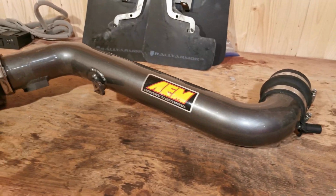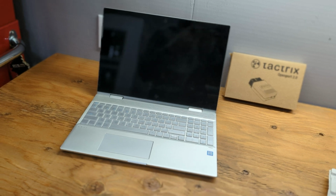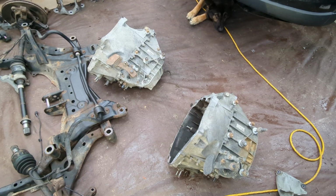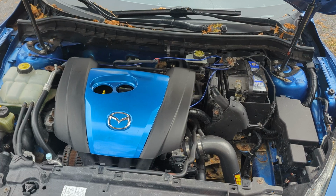Yeah, those base models are watered down, is what I would say. I think it's a really good car, really well balanced. I'm intrigued to see how the next one's gonna be. So for the 2-liter, there's probably way too many mods that I should have ever done to this car. I got the cold air intake, the catless exhaust manifold, the sauce tune, plus also the CX-5 shorter final drive transmission. I think it's going to help the 2-liter perform well.